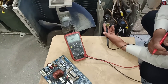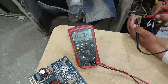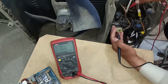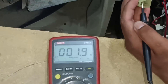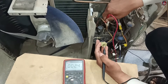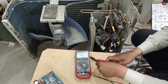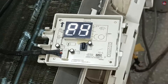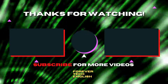The compressor shows 3.4 ohms across all three terminal pairs, which is consistent. However, checking the body short with the pipes, the value is only 2 ohms resistance — which is far too low. This means the compressor is conducting like a simple wire, which is why it sometimes starts, sometimes doesn't, and makes loud noise. The compressor winding has been short-circuited, and this is why the P4 error code is shown. The compressor is faulty.